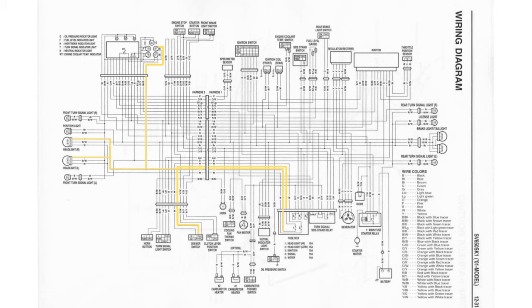If you go to the next one, which is B slash W — that stands for black and white — and if you follow that around, you'll see that that is actually your ground. It goes all the way to the negative pole of your battery, so you know it's going to be the ground for your lights. Moving on to the position light, which for this example we'll be using for the halo ring because that's our position light. You'll see that that colour is brown. The black and white next to it is your ground — so that's the ground for everything on your bike. The last colour is white. White is your low beam. You can follow that all around to your switch and you'll see that on your dimmer switch, that is your low beam.